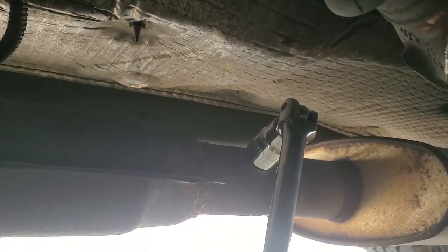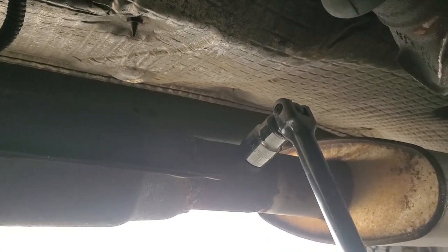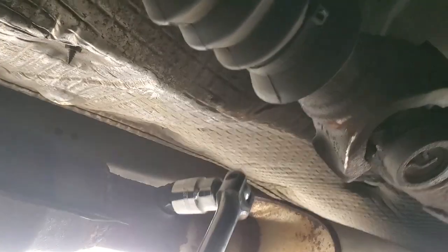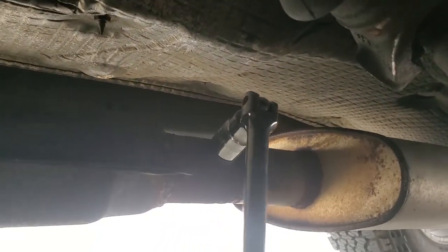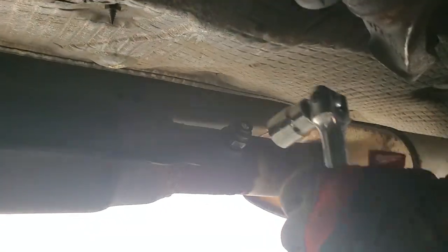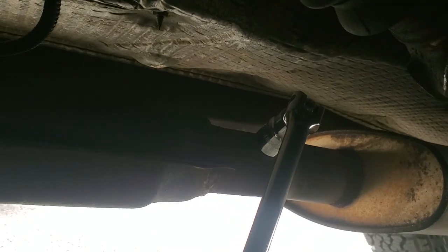This is a brave project - you never know what's going to happen. So many of you responded on my last O2 sensor video that you guys actually broke the bung out, and that is not fun - ripping out your bung hole. You don't want to do that because then you gotta weld yourself a new bung hole on top of the O2 sensor, and that's just a big headache.